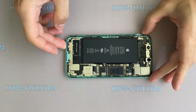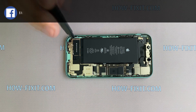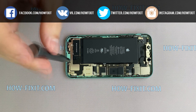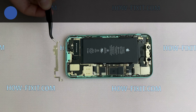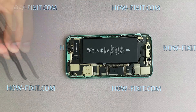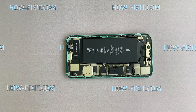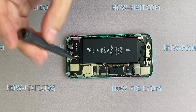To replace the battery on iPhone 11, I recommend removing the bottom speaker and taptic engine. Remove five screws and remove the antenna. Next, remove another two screws on the speaker. Now take a heater and heat the black tape between the speaker and the taptic engine, so it will be easier to peel off the tape without damage. Next, remove two more screws and remove the metal bracket.